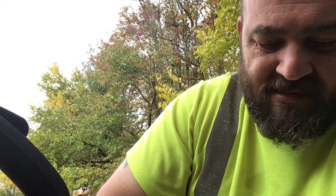Just a quick update here, though, on the Homelite 360. I gave it a try today, and it would not start. Well, I shouldn't say that. It started and ran for maybe 3 or 4 seconds, and it was really lean. I've been playing with a metering lever, and I think it is just a smidge too low right now. The 360 seems to be one of those saws that is very finicky about the tuning. And I think part of that is the carburetor. But it was definitely lean those few seconds I had it running.